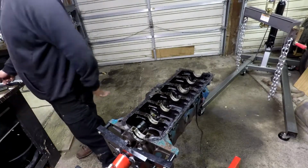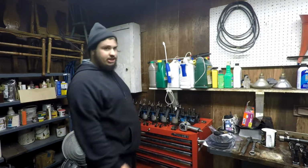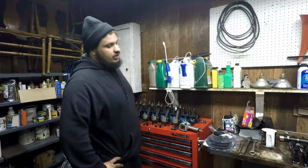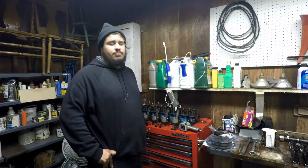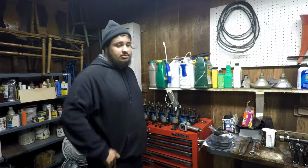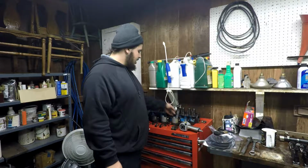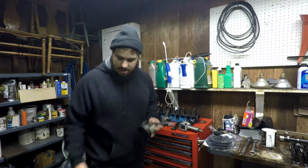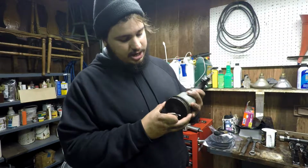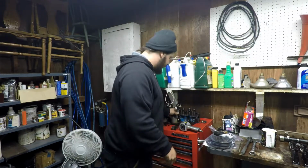Now, remember, if you watched my video titled "Meet My CJ7" or "Meet My Jeep," whatever I called it, you'll remember that I said I had a lot of blow-by. Blow-by is when compression is getting past the rings and into your block, and it raises the pressure inside of your engine. And every single cylinder, you see that? Every single piston has broken rings. It's almost always this top one here, but yeah, that's busted into quite a few chunks. See, it's all falling all over the place.